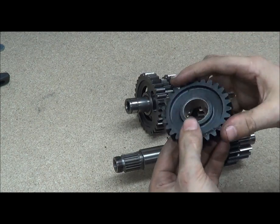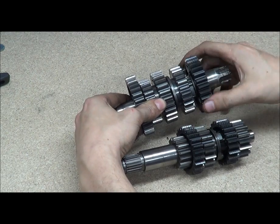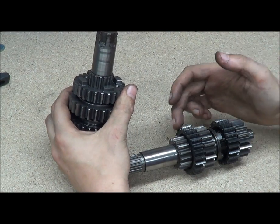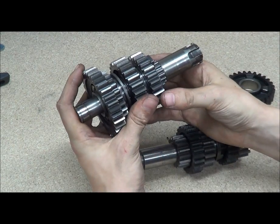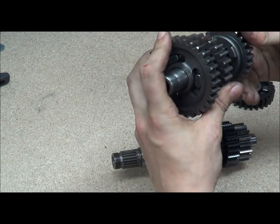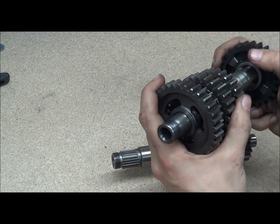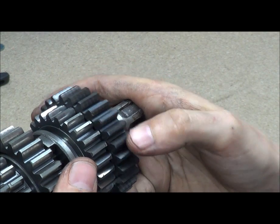I'll show you how these moveable gears work. If we take off second gear, it has a sleeve on the inside so it can rotate freely on the shaft. But what happens is you have these gaps — on this side it's flat, and on this side you have these recesses, and these are dog recesses. On the third gear moveable gear, you have these protrusions which are dogs. This gear is splined, and so is the shaft. So this means when one turns, it turns with the other. The shaft has to move with this gear.